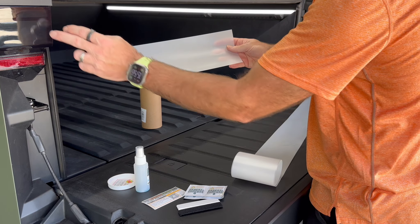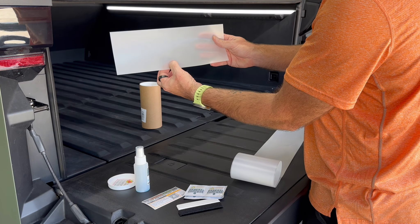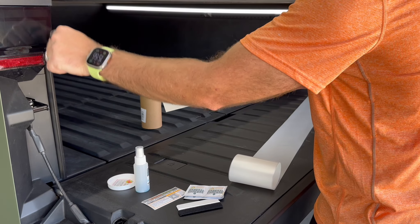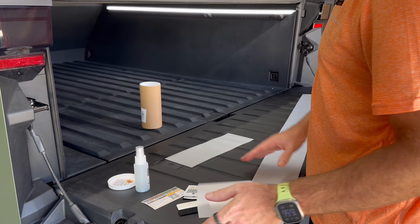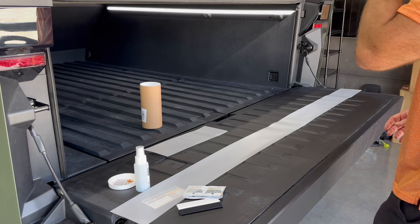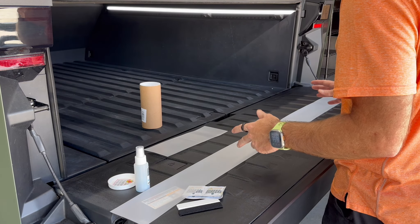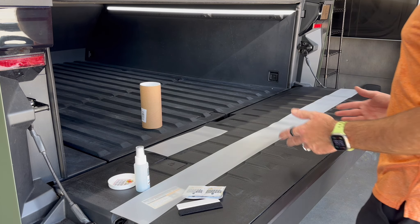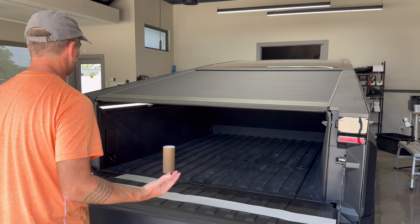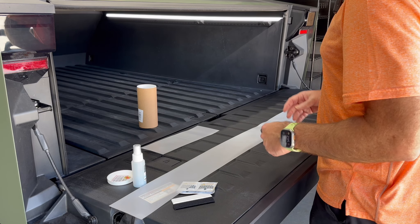First are the two side lights — the indicators. You can tell left from right: there's a little cutout here for the wrap around the edge. Then there's the obviously long center light. If you've already installed our front PPF light strip, this will be a little bit easier — it's not quite so long and skinny and unwieldy to handle. You want to install this inside where there's no wind to catch the PPF, no dust flying around, and make sure the temperature is fairly good.